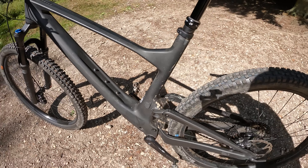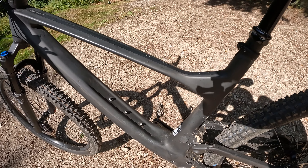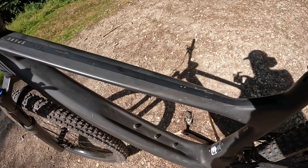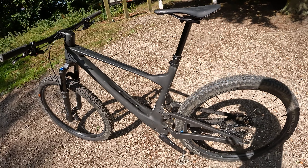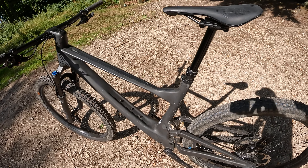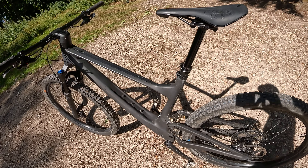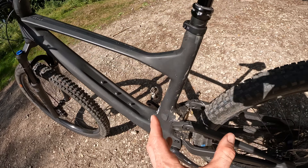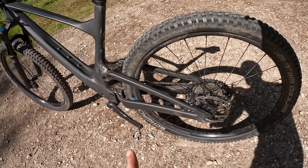The other difference between these 900 series bikes and the RC bikes is you get a full-length Fox Transfer dropper — full 150mm drop — not just a shorter drop. In terms of tire spec you get Schwalbe's Wicked Will, their new down-country 2.4 inch 29er tire. Scott actually fit a soft-compound front tire — you can see the orange stripe — which is only available on Scott Sparks and not publicly available yet; it looks like it'll be 2024 before you can buy it separately. That's a real shame because that tire is excellent and arguably one of the biggest differences in confidence on the bike. Even with the longer fork, wider bar, and different steering geometry, it's that tire that really pins it all together on the trail.